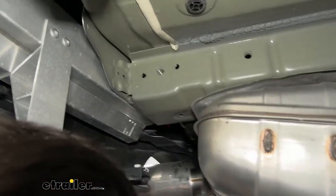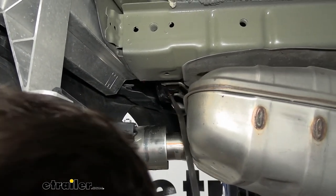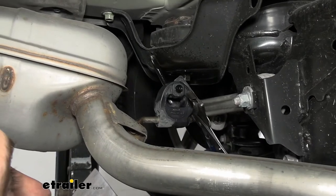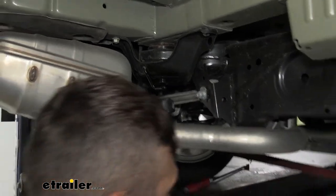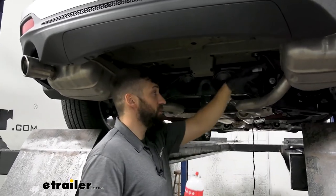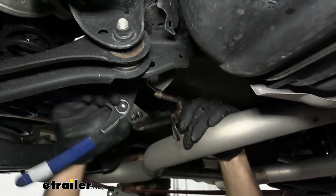The pry bar is probably going to be a little bit easier on the ones closest to the tailpipe, and then for the one behind the muffler, we'll use the exhaust hanger tool. We'll do the same on the other side. Our exhaust didn't move as much as I had wanted, but we can probably still install the hitch with just those two hangers removed on either side. I'm going to give myself a little more room — there are two more hangers located just directly behind this cross member that I'll go ahead and remove as well. Again, this isn't required.